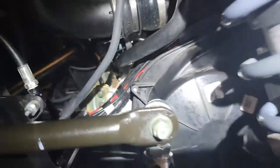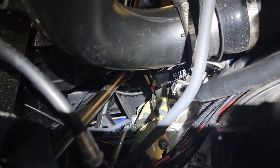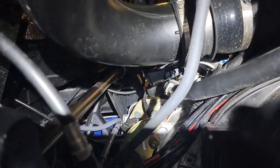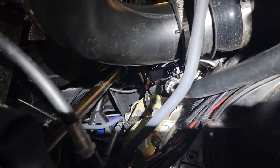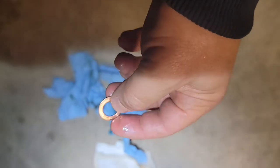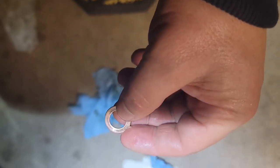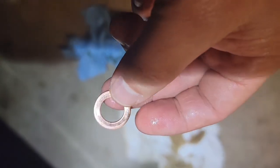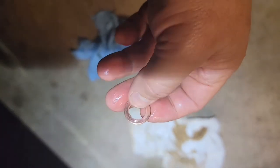Be sure to remove your rags from under the oil filter. Because I had those rags under the oil filter, I didn't get a drop on the motor. Here's the old copper washer — you could reuse it, and I've reused them before. But see how they tend to groove a little bit where they mate to the motor? I've had small seeping leaks from reusing copper washers, so it's worth replacing to avoid that.